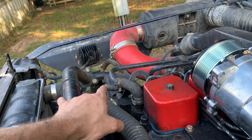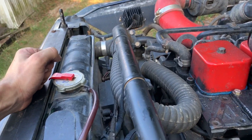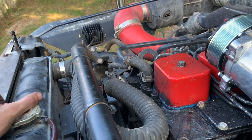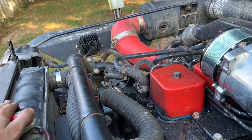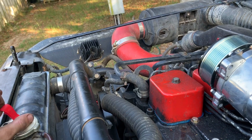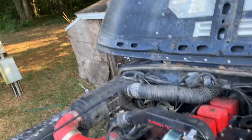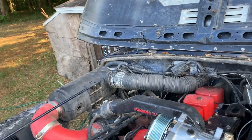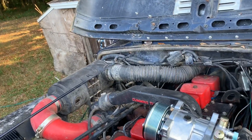I'm probably going to go toward making some sort of bracket on the passenger side — I just haven't fully made up my mind yet, but I think that's what I'll end up doing. As soon as the rest of the parts come in — the condenser came with an evaporator and my AC hose kit came with an orifice tube — I need to decide whether I want to run an orifice tube and accumulator, or a receiver-dryer and a TXV — the thermal expansion valve.